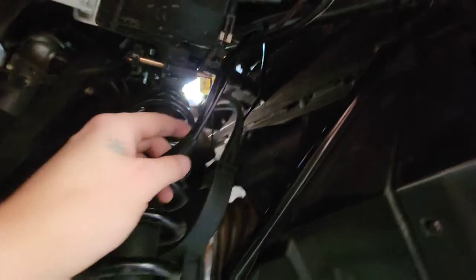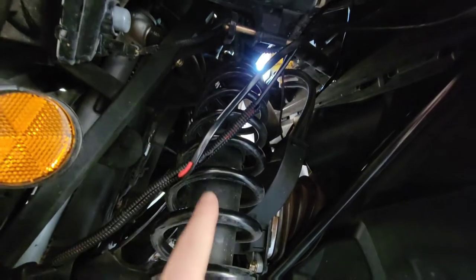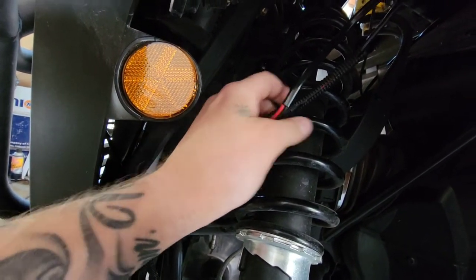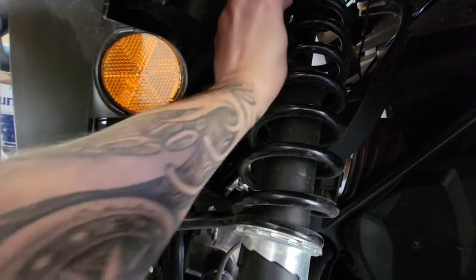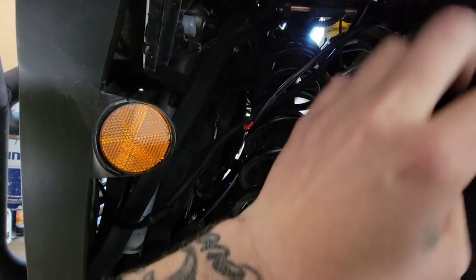Moving to your smaller front bar — you have your wire going up to the big one, and your second lead is spliced in. We have it pinched and then have the second lead wired up and heat shrinked. We're wire looming the exposed wire, then electrical taping to make sure it's all sealed up. We'll zip tie it at a couple of points to keep the wire off your radiator, out of the suspension travel, and tucked up clean.